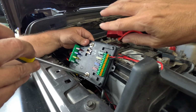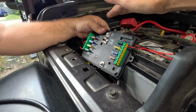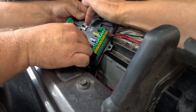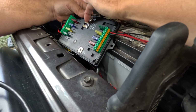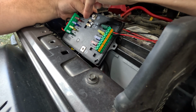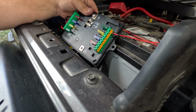on the installation. Here's the thing. We are going to be running this on battery mode. We are not going to use the accessory item that hooks into your fuse box. You can do that if you choose. We are not going to do that. This switch moves back and forth depending how you're using it. We're using battery mode, so we want it moved this direction. If you're using the accessory, you'd move it here. There is the adapter for this included, where you would plug this in and plug it into your fuse box into an accessory fuse. We're not doing that. We're going to use this and go directly, well, we're plugging this and this to the battery, and this will go directly to the switch into the inside of the Jeep.